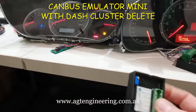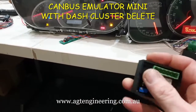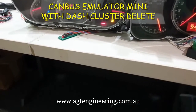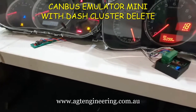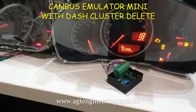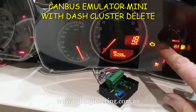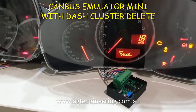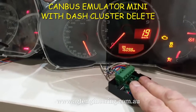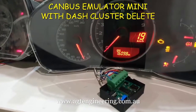The other thing I didn't mention — we've got an option on these emulator minis now: a couple of outputs. This one has only got the 6-pin connector, but if optioned with the spare outputs, that'll turn into an 8-pin connector. That can be used for things like check engine lights, cruise control set lights, and a few different things you can program into that. The late model clusters hardly have any hardwired inputs at all — for example, the check engine light is via CAN, so there's no wire to the computer that does the check engine light. You can configure this to have an output for a check engine light that then goes through a lamp on your dash, and the other output could be a cruise control set light.